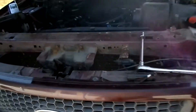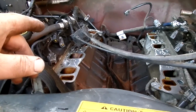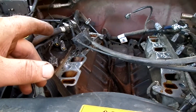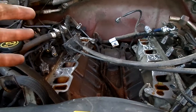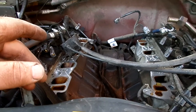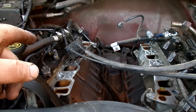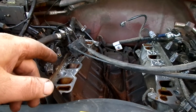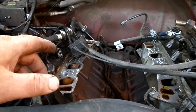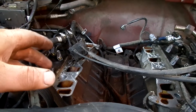Back on the 2000 F-150 — when I put the replacement intake manifold on earlier, I wasn't getting any water in oil or coolant mixing. But since then my number four cylinder hydro-locked, filled up full of coolant and it wouldn't turn over. I pulled the plugs out one at a time until I found the one with coolant in it, and then the engine would turn over. So we definitely have a blown head gasket or something worse. I guess the gallons of stop leak they poured into it had just temporarily stopped that leak.